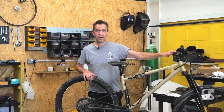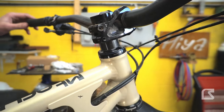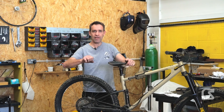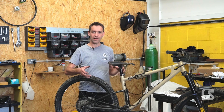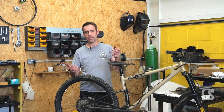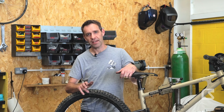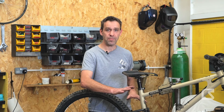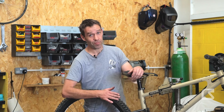I'm running O-chain, which helps reduce vibrations in the chain and does a really good job. I'm also running a Cane Creek damping headset with a little bit of steering damping. I'd like to try grips with elastomers in them as well. I think there are lots of other ways we can add damping to our frames. Going back to where this all started — pedal kickback — I don't think it's real. It's obviously an effect people feel, but I think it's chain slap, it's flapping chains.